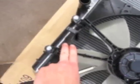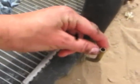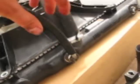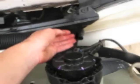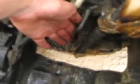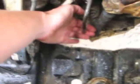Now that I have all of the hoses on and the fan is on, take off these little protective caps — they're not doing you any good. I have removed the hose that was attached to this metal tube and I'm putting it on the new radiator. It's easier to put this on while the radiator is out of the car, because it's impossible to reach the hose clamp under there. Now I have this hose connected to the radiator that's about to go in — it's going to attach to this metal tube facing downwards.